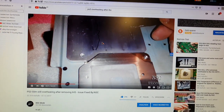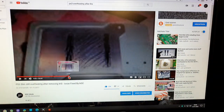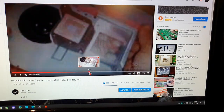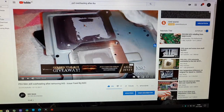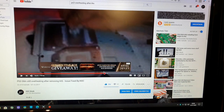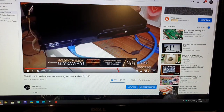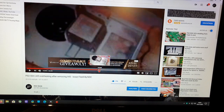I have also here explained it on the video and I have really told people what the problem was inside. The problem was that after I have just lapped it there — I have just ground it a little bit — after that the PlayStation was working nice. I have made some tests for myself and I still saw that something was not great. Later I showed where it's still too much metal, and that's why the cooling was really bad. I think I had just removed the heat spreaders, checked the heat spreader itself — this one was looking great because I tested also with the lights, but this one was just bad. Right and left it was just bent. And yeah this is all that I just wanted to show you — the same thing we got on these CPUs.